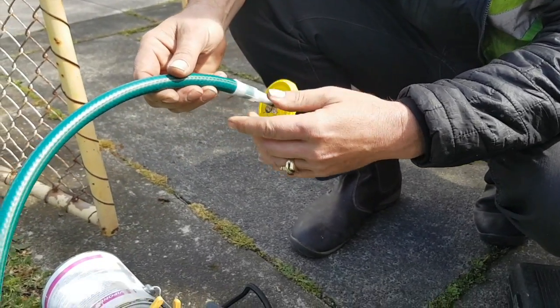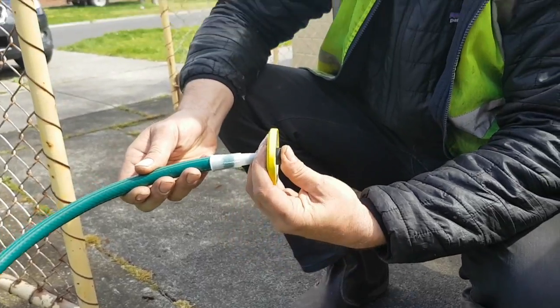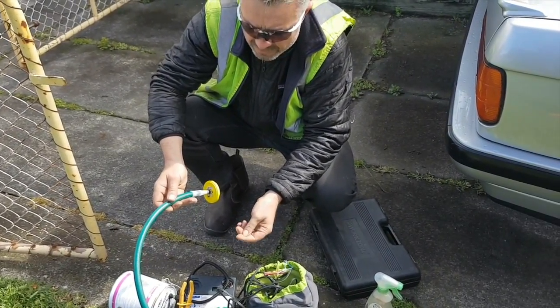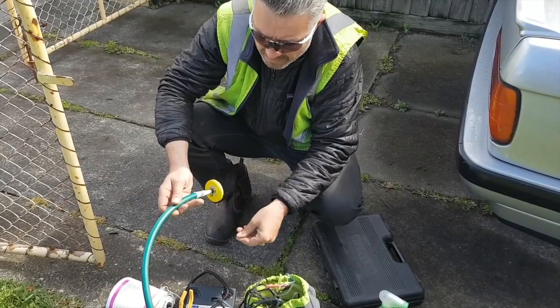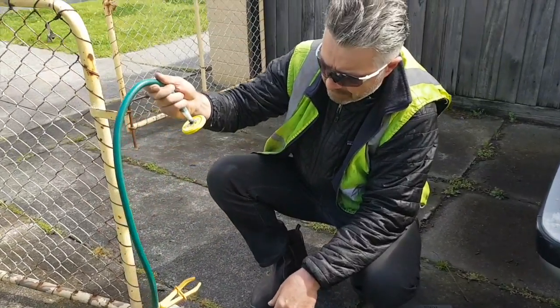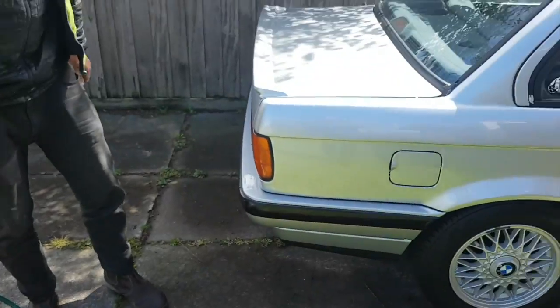And that's why you can see, is that? Well, otherwise you can blow out the cam seals, for instance, on certain engines. It's just generally not good to give it too much pressure, mainly for the reason of seals, and I mean, it's just not necessary. 1 to 2 psi is actually still quite a lot. Yeah, absolutely. So this is the car.